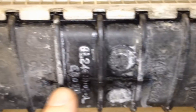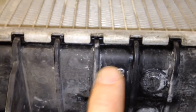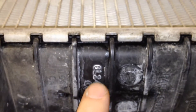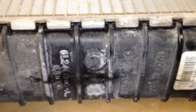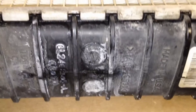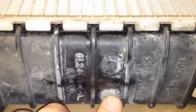Also look for this white powdery residue — it's more than just water stains from hard water; it's actual dried-up coolant. You can find stains like this all over the top of the radiator, blown back onto the hoses or the upper intake. All that white powder means it's coming from the radiator — it failed, blew off, dried up, and left witness marks for you.